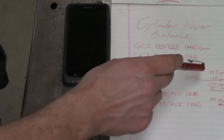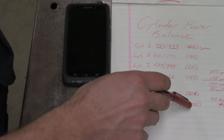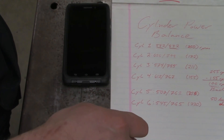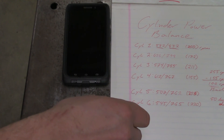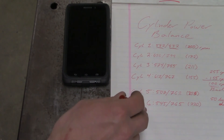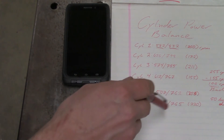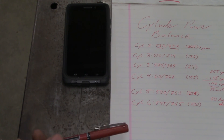Don't be afraid — always double check too. When you're performing a cylinder power balance test, if you get a lot of good numbers towards the end but the beginning ones aren't that great, go back through and do those first couple of cylinders again just to double check your numbers. Double check to verify, then go through some further tests. Remember, we don't want any difference above 50 RPMs — we want to stay within 50 RPMs across all cylinders. That should be our acceptable drop. This is how to perform a cylinder power balance test. Thank you for watching.